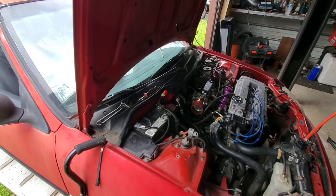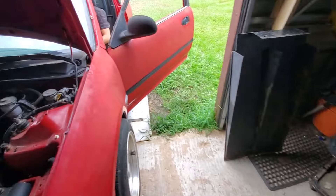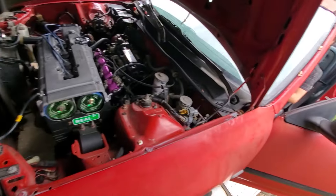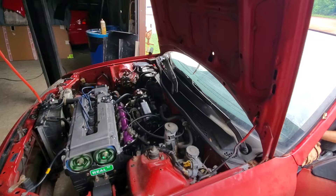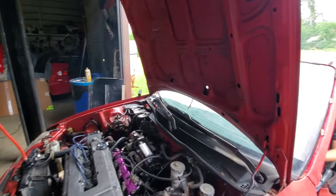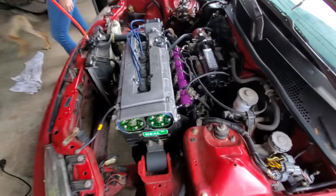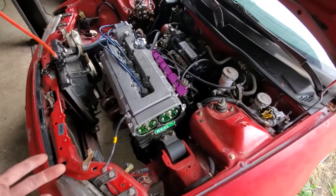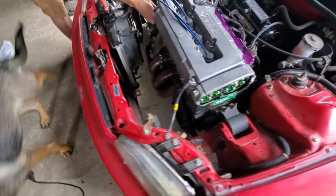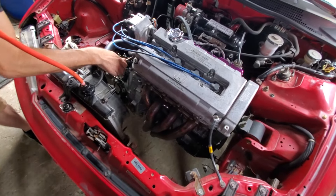Whoa, whoa, okay — don't go too high. Oil pressure at 80, 79 — hell yeah! I gotta pause this. Unfortunately I had to put my camera down because I had to get inside the car while he did the timing, because my 58-year-old cancer-blind ass can't see the marks. Mike set it at 16 degrees while I held it at a thousand RPM.